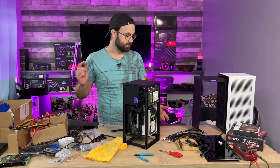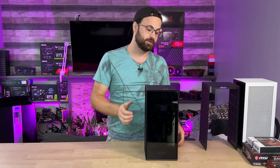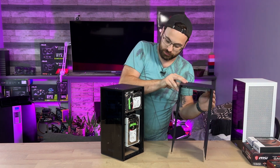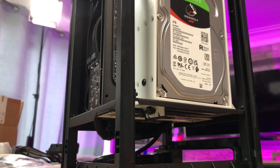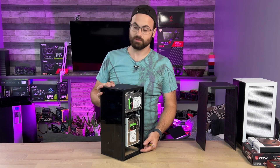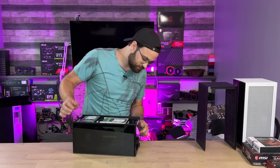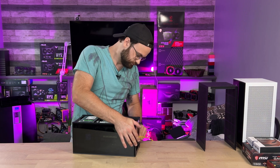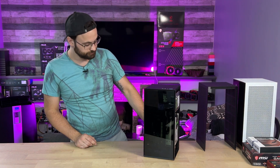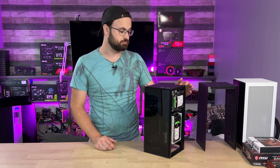I'm so grateful I picked up a portable AC for in here. It's back assembled as much as possible — I can't slide the cover on because the hard drive is sticking up; I need to modify that bracket. I think I already installed TrueNAS on this when I was playing around with it over a month ago. My plan is to plug in ethernet and power, let the router assign an IP, find it on my phone app, and hopefully see all drives connected.